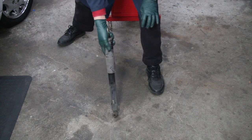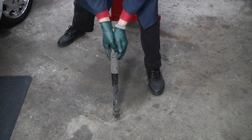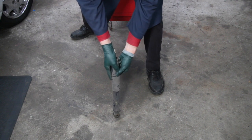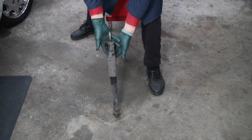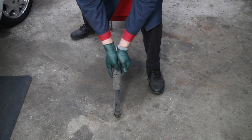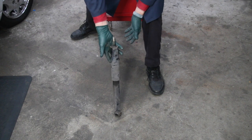Here's a left rear shock that I removed yesterday. Let's do a push down test here and see how this responds. You go all the way down and then release it — it should come up. As I push down I'm looking for any flat spots. This one feels pretty good.